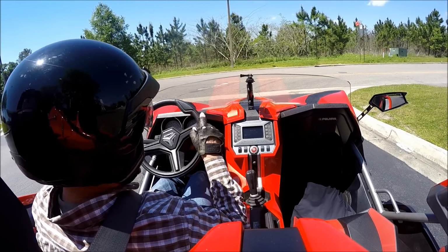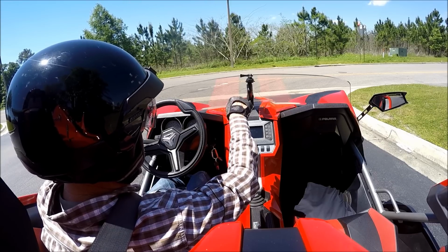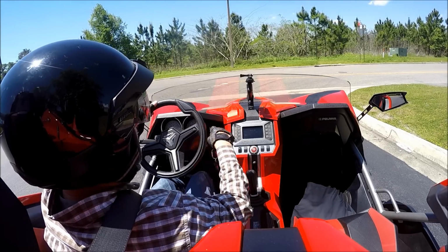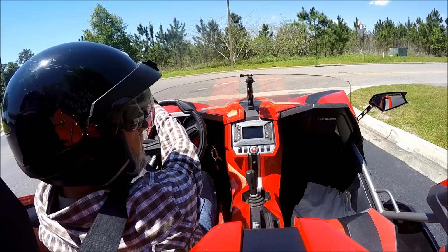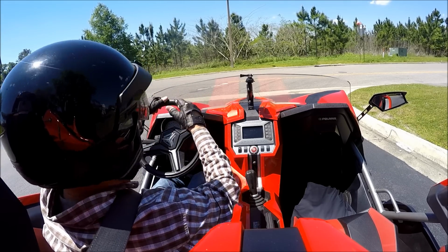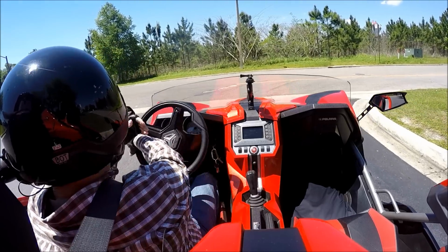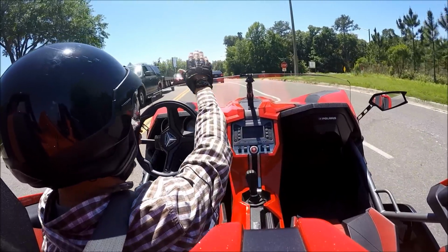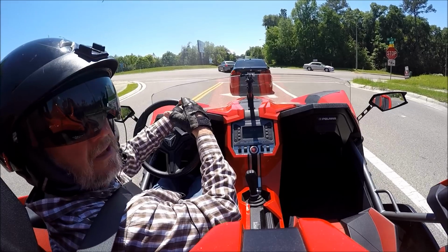Now one other tip, you have only 5 inches of clearance on the front snout or the air spoiler. If I were to go straight across, I might hit that pavement. So here's what you do: you always go at an angle when you have a dip that you've got to go over. Do a 45 or as sharp of an angle as you can. I'm going to show you here. Like this. Okay? Never straight down.